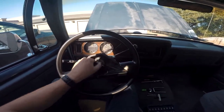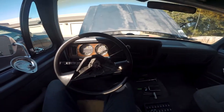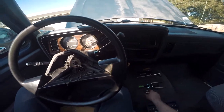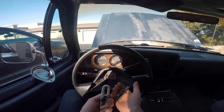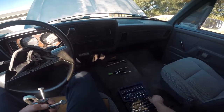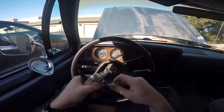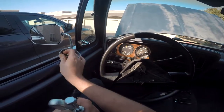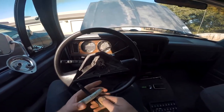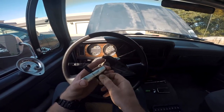Take that nut and put it in the magnet tray so we don't have to worry about it. Now since that is free, grab your puller. The wrong size heads won't work — for me it's good old 14 millimeter, that's what it's going to be. Set that on the magnet tray so you don't lose it, and then back the center bolt out to give yourself some slack.